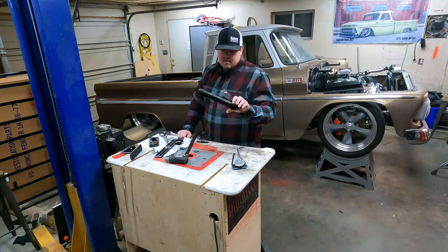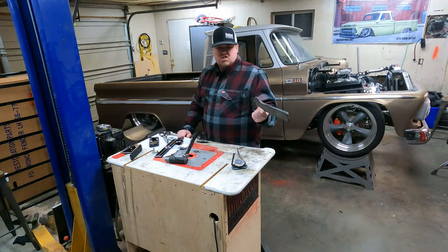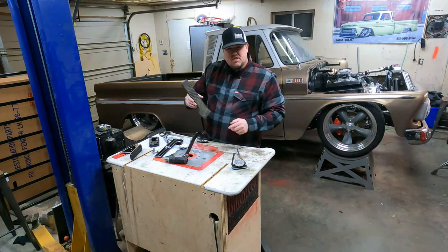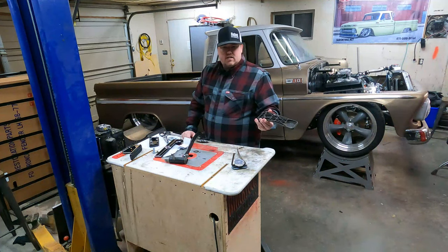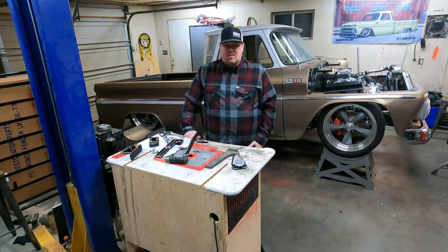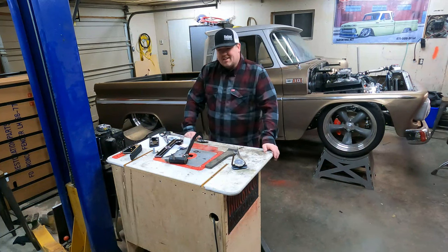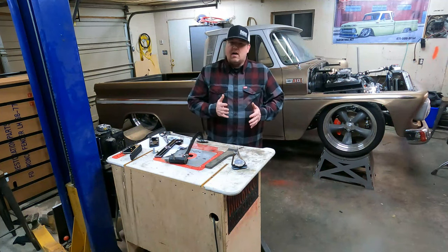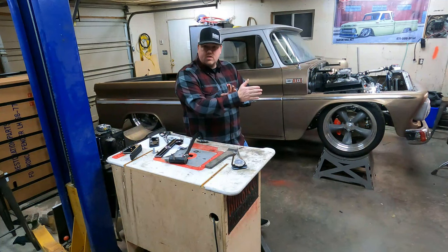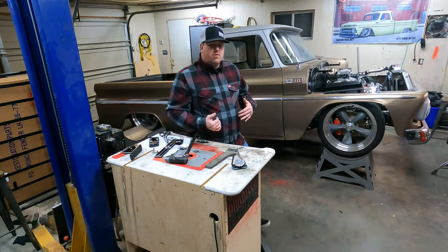I had the Chevy 2 project — I looked at the '66 Chevy 2 pedal, which is similar to the factory pedal on the truck except it's kind of cut in the opposite direction. I figured I need a stock '65 C10 gas pedal or this, so I went out — because like two years ago I threw away the mechanism for the gas pedal like a big dummy — and bought the stock mechanism. The problem with the stock mechanism for the '65 is that it puts a metal lever on the outside of the firewall, and then it's a hard bar all the way to the carburetor.